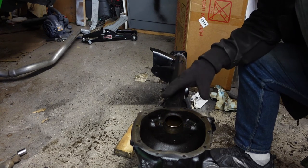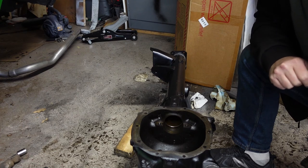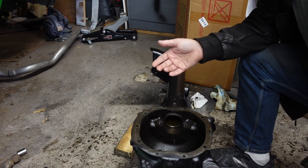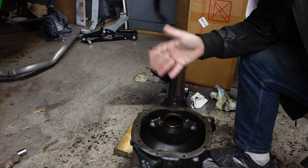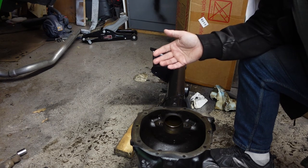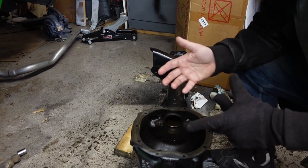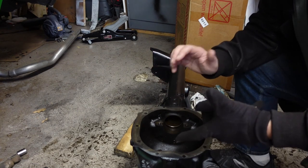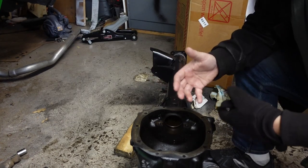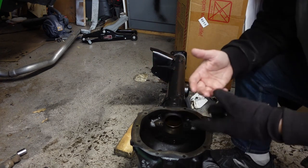I think I'm going to just cut it short here. I appreciate everybody watching, liking, and subscribing — I've got a bunch of new subscribers in the last week, really appreciate it. If you've done one of these and have suggestions, message me through the channel. This is definitely something you can do yourself. My impact driver works really well — otherwise you have to make a piece to hold the pinion so it doesn't turn. The impact driver is nice because you can just hold the yoke and it'll spin on there. And if you mess it up, as long as your yoke doesn't stick, you can just back it off, get a new crush sleeve, and try again.